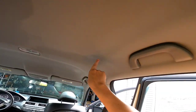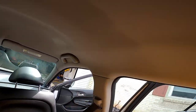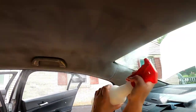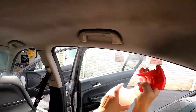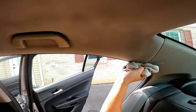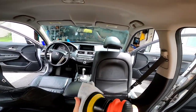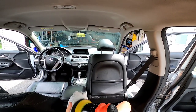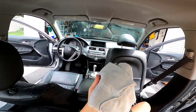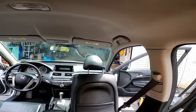All right, last section for us to clean. We've got some coke splatter or drink splatter here. We're going to go heavy on those two stains right there. You can see we're transferring some of the staining from our pad to the microfiber. Give this a fresh spritz so we have some fresh solution.